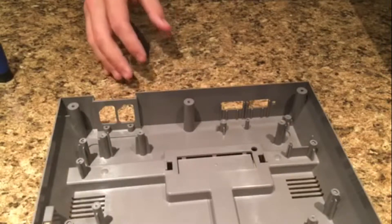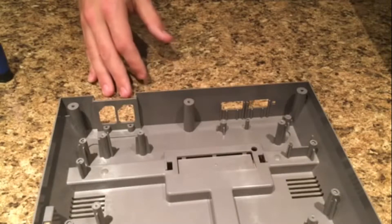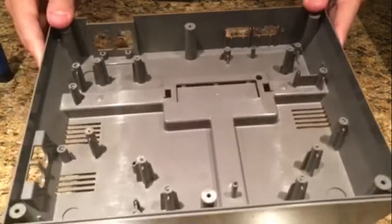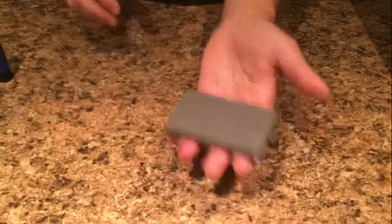So we're completely done with disassembly. Now I'm going to show you everything that's washable with water and soap: your bottom piece, both pieces of RF shielding, your cartridge tray, the little controller port cover, the bottom plate, and your lid. All washable — so go ahead and wash those and clean your motherboard however you choose, and I'll be back with putting it back together.